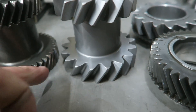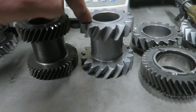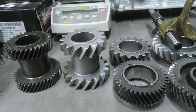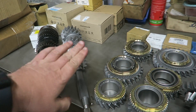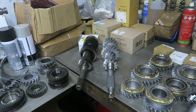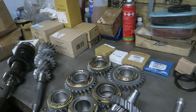The Monster gear set has much bigger cross sections at the base of the teeth - they're a lot stronger. Because the teeth are more spaced out it gives you that classic whine. Some of you have probably heard how this sounds on Nick at Team Prawn Racing's gearbox - sounds absolutely epic. Rather than just going for the four-to-sixth kit, I wanted the whole thing because it also means I get a stronger input shaft for the T4, as it's a big bus doing a fair bit of work.